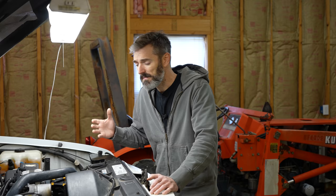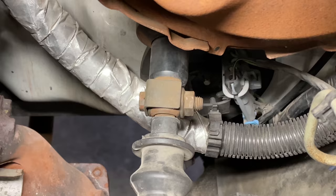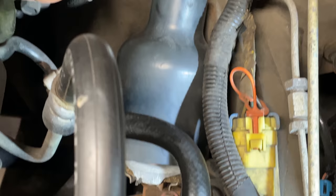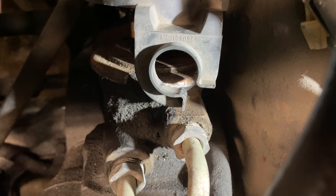So why am I doing this? Every now and again I do feel and hear a clunking sound when I turn my wheel driving really slowly. I don't know if that rag joint is to blame, but I'm about to embark upon a full rebuild of the front end of this truck. This is the original steering shaft. You can see the single bolt here that holds the top of the shaft in, and down towards the bottom, the other single bolt that holds it to the gearbox. These GM factory steering shafts have a dust boot held in with a plastic collar that fits around this nut.